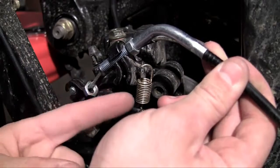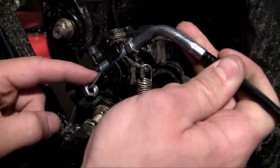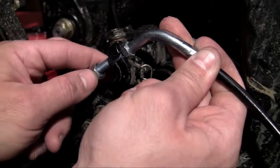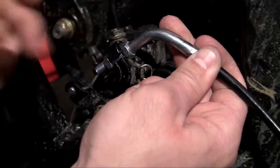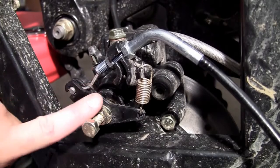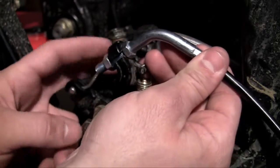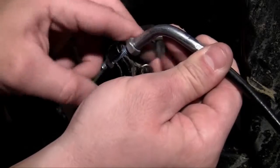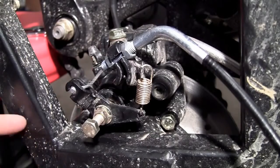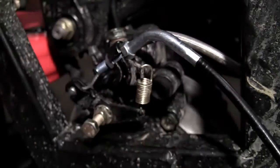The reason you do this is because we haven't put the other side of the parking brake on the handle side yet. To make sure we have enough cable, we want to get this as loose as possible before making any adjustments — just for installation purposes. The point of this nut is just to keep everything tight, so tighten that up. I'll show you how to adjust it: if it's loose, you unscrew this a little bit and tighten this one until it gets tighter. But for now, I'm going to loosen it back up.